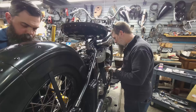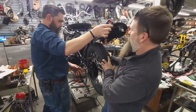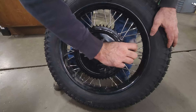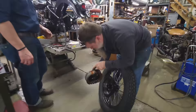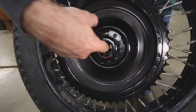Now we're going to have to retime it. Free up the rear wheel — that's what we're going for now. When we spin the wheel over, we're just getting this little bit of drag and I don't know what it is. The brake is tight but it's not what's slowing everything up, I don't believe. The pads are right there, which is great — that's brake life. I don't know if there's one too many shims in the bearing.